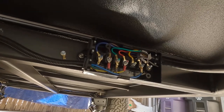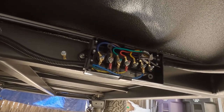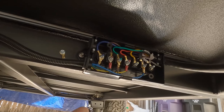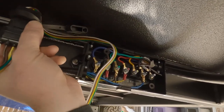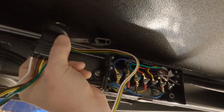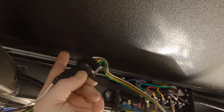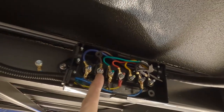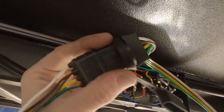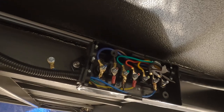This is what the wiring junction box looks like under the trailer that comes from the vehicle. The first thing we're going to do is mount this connector up here, so we're going to drill a hole and run the wires and connect them. That way we can just unplug the top of the trailer from the bottom of the trailer if we need to.